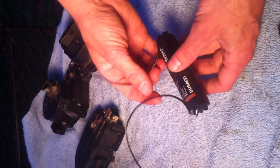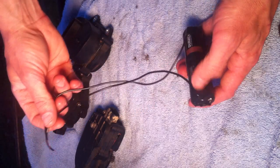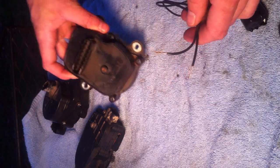As shown in the manual, there's two C batteries taped together, positive to negative, with my wire run down — makes three volts. That way you don't damage anything in here if you do touch the wrong terminals.